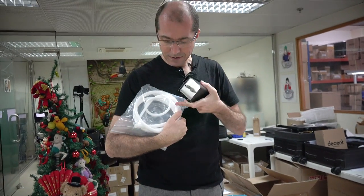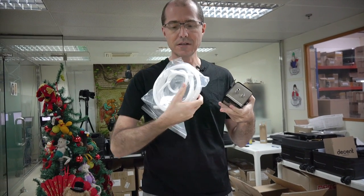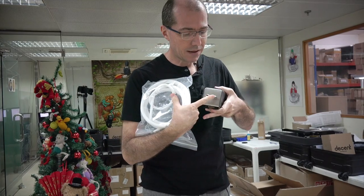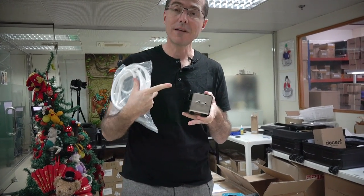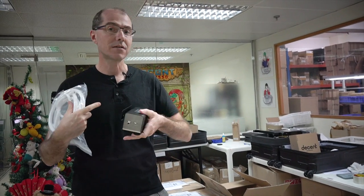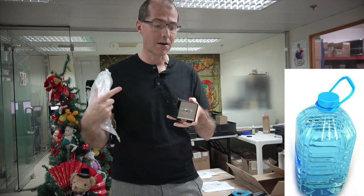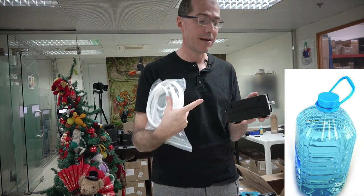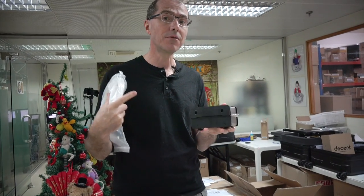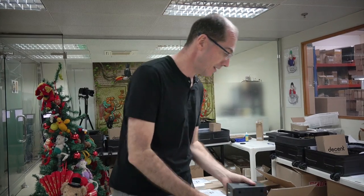Here you can see we've given you all sorts of different components: the ethernet cable, the small tube which goes from here to the espresso machine, and the big tube which goes to your water tank. You only need this catering kit if you're going to be using store-bought water or some other non-pressurized water source, because there is a pump inside which is going to suck water out of that source. It'll suck water up to three meters in height difference, so you can put your water wherever it's convenient.